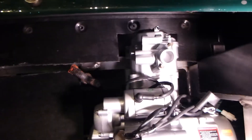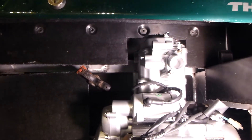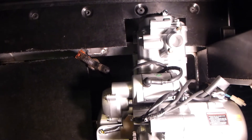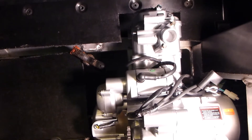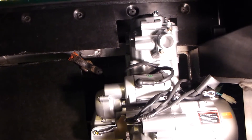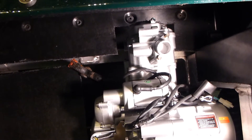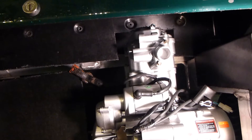It looks like it's all going to fit in here. Of course, we have more fitting to do, and we have just a few engineering challenges left — like building a good intake manifold. The stock one was about a mile long, so we'll cut the middle out and try to join the two. If not, we'll make a custom one out of steel.